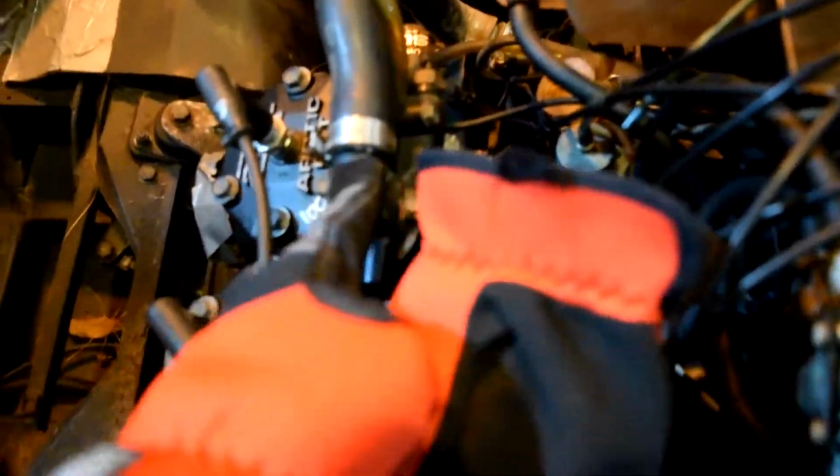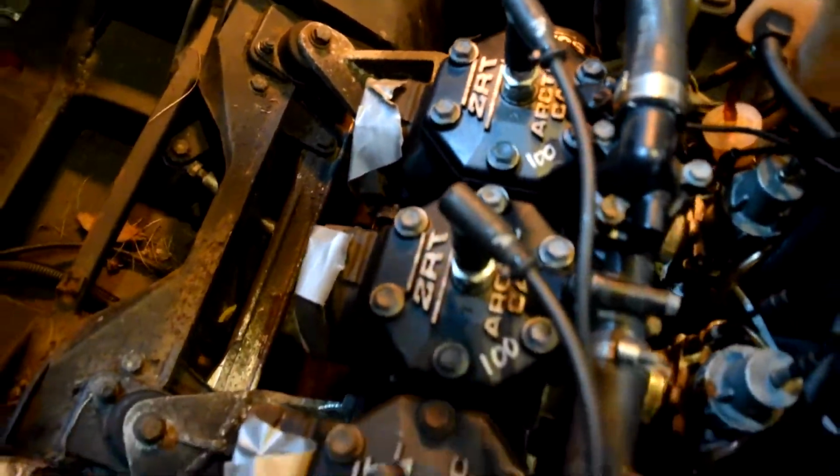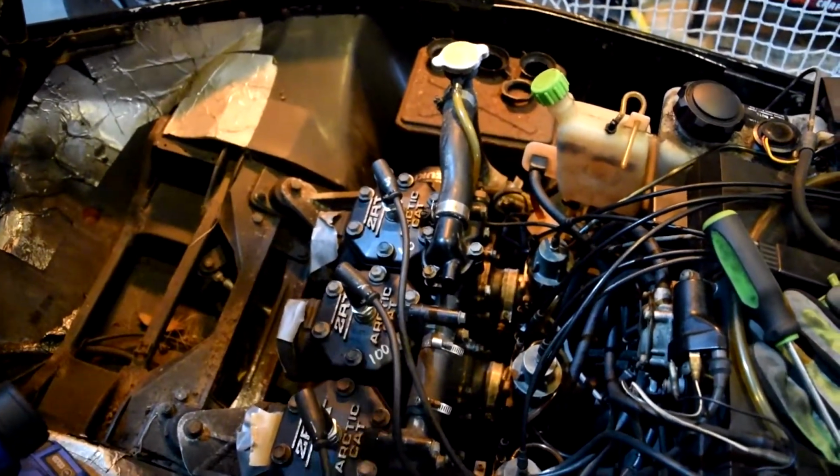So I'm gonna start popping this right here on each cylinder off. Just pop the whole coolant pipe off and pull that back, and looks like we're gonna pop the carbs back off, and then we'll just yank those heads out and pop the new gasket in, clean her all up, get that all sealed up, and fill her back up with coolant.